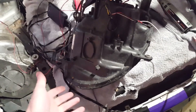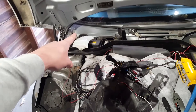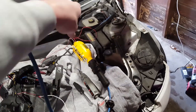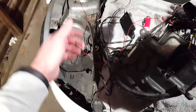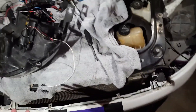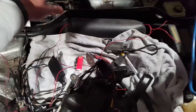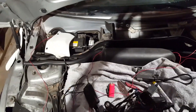I'm not going to be able to fix it without pulling this whole headlight apart, so we're just not going to have brights on one headlight and we'll have them on the other one. It'll still be okay - we'll still have the headlight coming on whether the brights or low beams are on, it's just not going to be raised on one side. If I ever have to take these apart, I'll fix it. All we got to do is put in that inline fuse, route the wires, plug everything in, and put everything back together. I got the inline fuse - I'm going to bolt the headlights in and put the grill back in and then start running the wires, because everything needs to be in this area before I can hook them all up to the inline fuse.